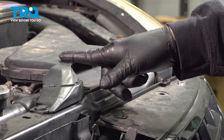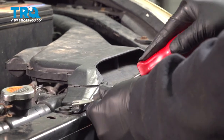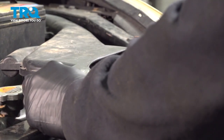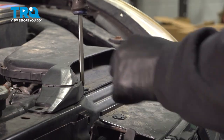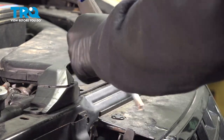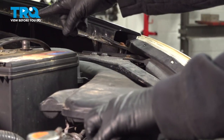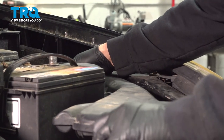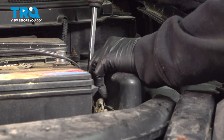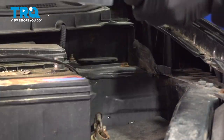We're going to remove our air intake here. There are going to be three plastic buttons — use your trim tool to go ahead and remove them. Our particular vehicle has different variants of our plastic clips, so we're just going to use different tools to pull them out. Once those are removed, go ahead and pull this up. I'm going to pull the air intake out of the air box where the filter is located. Use our flathead screwdriver and just lift up on the little tab right here. Pop this out, do the same for the back side, pop that off and set that aside.